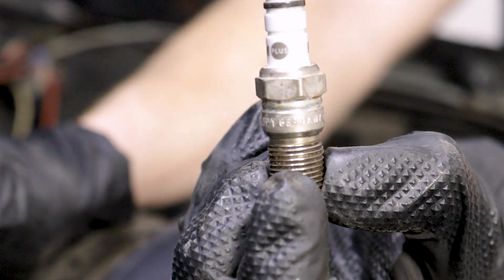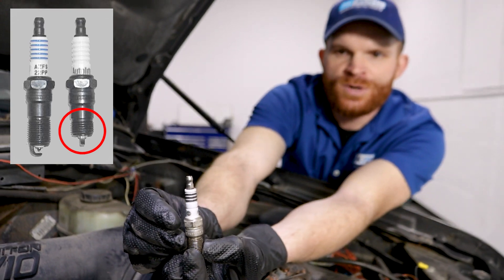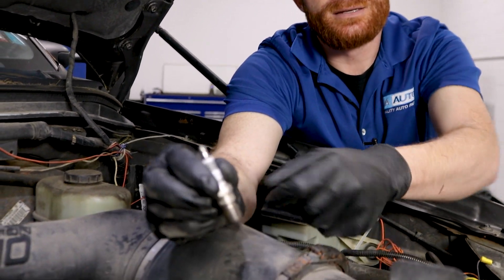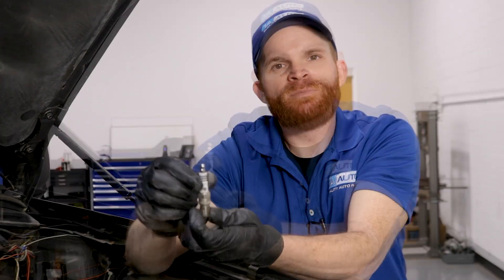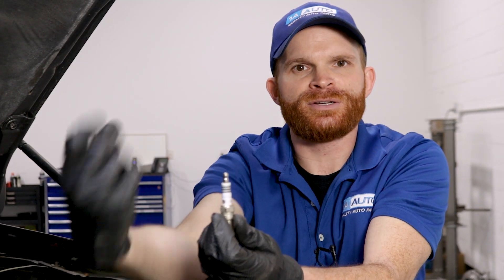On the original spark plugs for these and the original aluminum heads, they really didn't have very much of a threaded area. The aluminum heads are of course a soft metal, while the spark plugs are a much harder metal. With the heat cycle of the engine running and getting warm and then turning off and cooling down over and over, the metals are gonna adhere to each other. Whether it's while you're driving and you actually hear something, or even when you try to remove the spark plugs to service them, you end up pulling out the threads of the aluminum heads. You pull out the spark plug and you're gonna see a whole bunch of crud inside there that looks like aluminum — because it is. If you find that while driving you heard a little pop noise, found a little misfire, had a check engine light, and lack of power, more than likely it's due to the lack of threading and the aluminum head making the spark plug vibrate around and pop out of the cylinder head, causing compression to evacuate the cylinder.